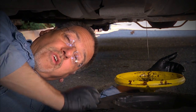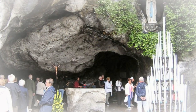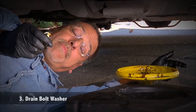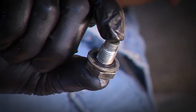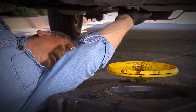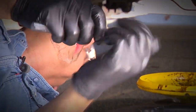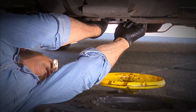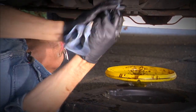Here's the maxim about changing oil: no matter how long you leave this plug out, oil is going to keep coming out. It's the damnedest thing. Now, some cars want you to use a new washer on the drain bolt — I'm pretty lazy, I normally don't, and it seems to work just fine. Nice clean shiny drain bolt — that's what you want to see. Carefully re-thread that drain plug back in; you don't want to cross-thread or strip those threads — that's a real nightmare. Go ahead and snug it up; don't go too far, you can easily strip these things. Snug is fine. Wipe away the excess oil so you can spot drips later.